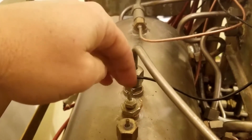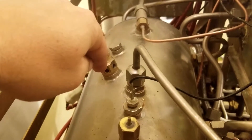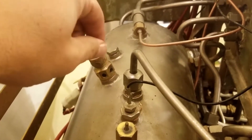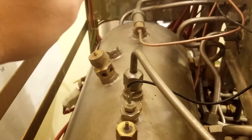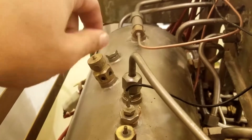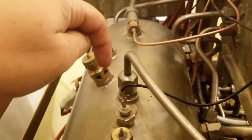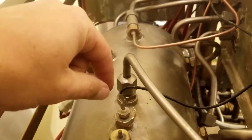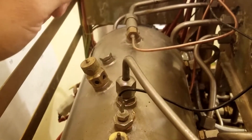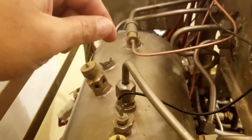Water will rise to the end of this probe — that's basically how it works. If you want the probe all the way at the bottom, the water stops rising and the rest of your boiler is filled with steam. If you have the probe all the way at the top, the water keeps rising, so you get a bunch of water and a little bit of steam. If you want to make more Americanos, you'll need more water in the system — pull the probe up. If you want to steam more lattes, you want more steam — push the probe down.